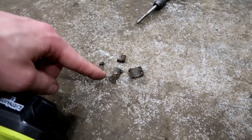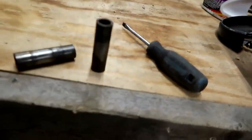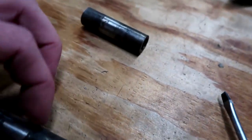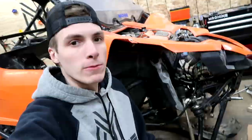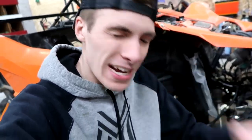I really hate to stop right now, but here's the problem with the lower control arm on this side. That's the old bushing — that bushing is no good. And there are the three remaining bushings. It appears that Crush and I have a slight problem, and that slight problem is the fact that these spacers are shot. This one's cracked in two spots on the top — you can see a hairline crack right there, and if I rotate it there's a second one. On this end the other side is intact, but this one has a hairline crack as well. You can just barely see it but that's cracked, which means the front end is really broken.